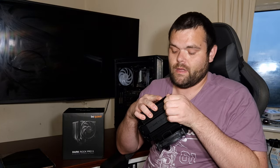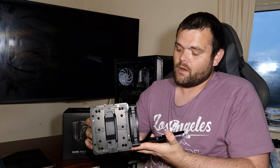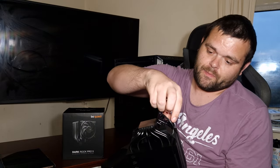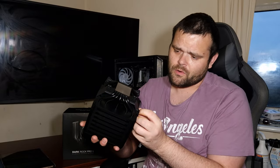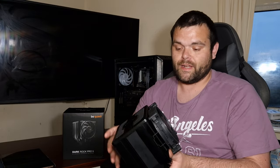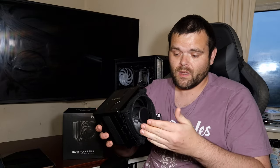Overall, the design is fantastic. The middle fan has a little bracket housing with magnets, and there's a Q and P toggle switch for quiet and performance mode. Both fans are connected with a little connector that comes off to a 4-pin header. They've also updated the mounting — I'm very happy they changed it. Before, parts would be separate, but mounting inside the middle of the cooler is now a lot better and easier. It's got Pro fans at the front and a 135mm custom Pro fan as well.